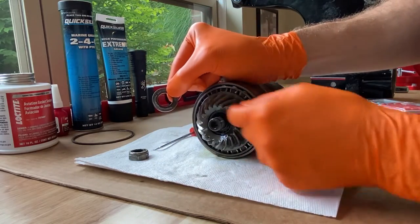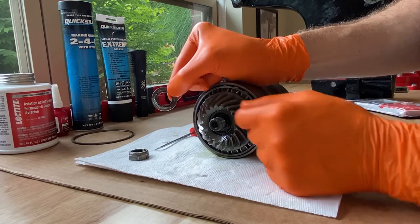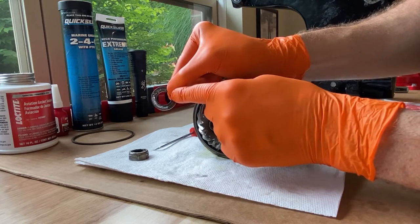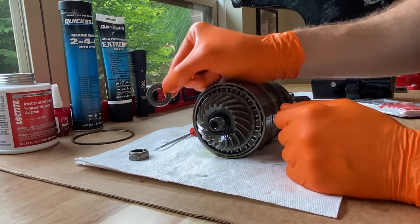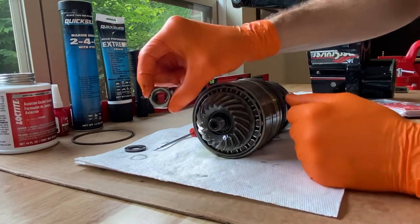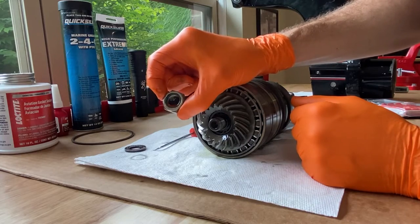When you reinsert your brand new washer — because these old washers cannot be used again. These are already compressed with the preload and used, and in the event that you try to use this old washer to set a new preload, you are setting yourself up for disaster. Replace the washer. Most people replace the nut, but in the manual we don't see anywhere it says you have to. We are going to replace the nut anyway — it was only about $3, maybe $4.